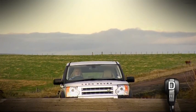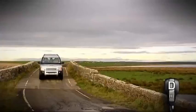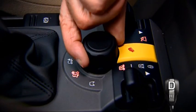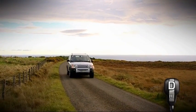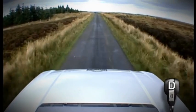When you return to the road, remember to reset your vehicle's controls. Re-inflate the tires if pressures were lowered while off-road. Return terrain response to the general program setting, which will automatically adjust the vehicle's computerized systems for road driving.